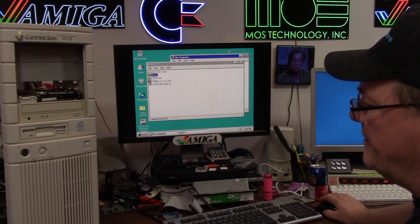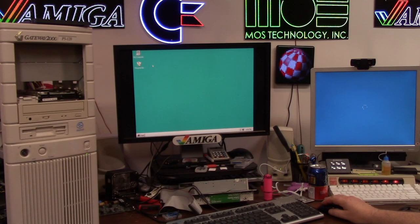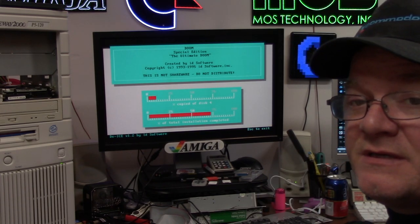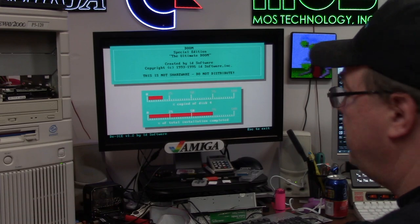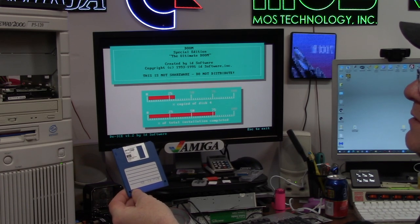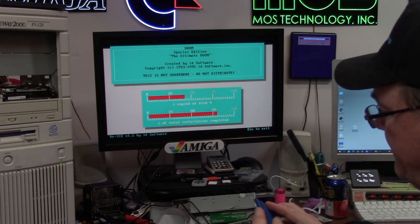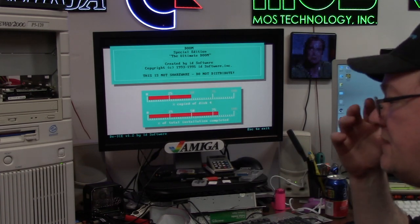It's nice to see this motherboard functions — this is the original motherboard to this machine. I'm going to keep it together; I was going to put another build in it like an Athlon or something cool with a newer motherboard. Windows 95 on an S3 Trio 64 24-bit video. I really have to commend Gateway on the quality of this disk drive. I bought a bunch of double-density disks from a computer store that doesn't exist anymore, drilled a hole in the corner to make them high-density — just like the old C64 days.